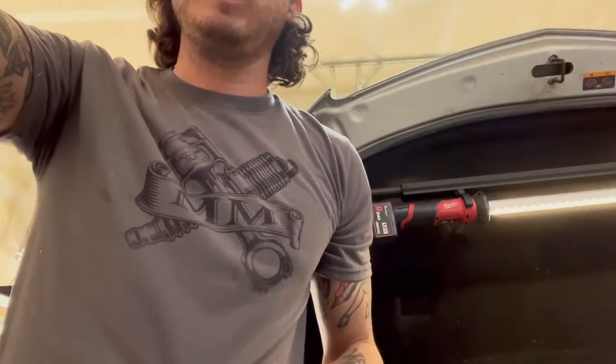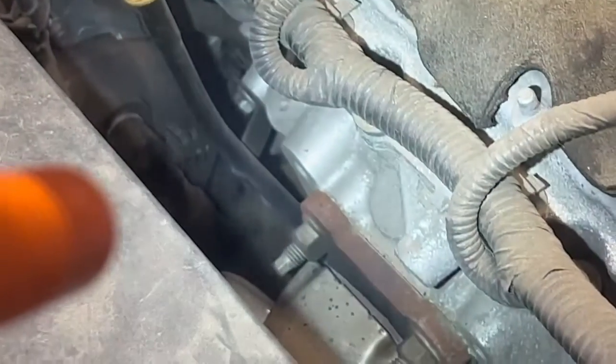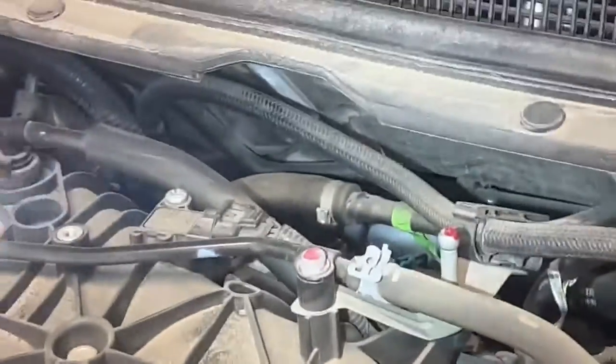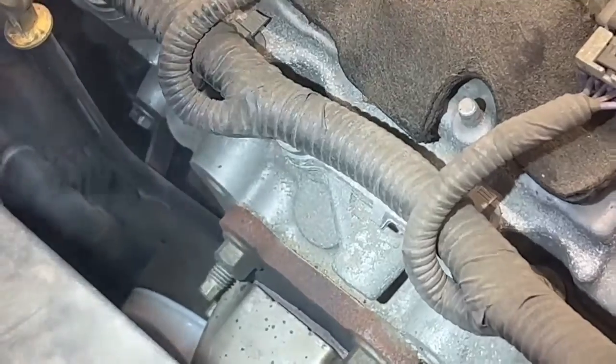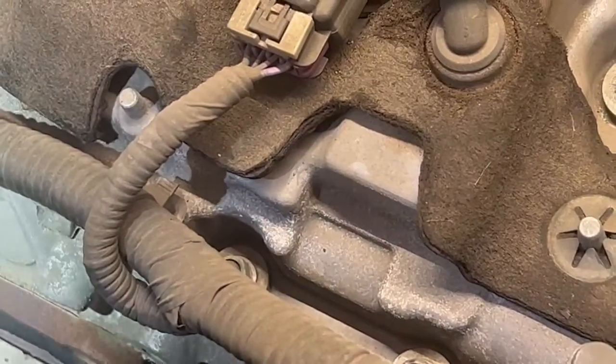Being a tech it's really all about options — option A, option B, option C. If you're having a really bad day you're probably on option E, which is burn the car down and collect the insurance — but I'm joking, don't do that. We'll turn our smoke machine back on, hooked up to that exhaust with a light, and we'll wait. Alright folks, we found our leak — see that smoke? Left hand side, which is good news for me and the customer because that gasket should be relatively easy to knock out. I was really glad it's not on that backside because that would be a total pain. That shouldn't be a very expensive quote for her — I'll get that over to her along with the invoice for the seatbelt.